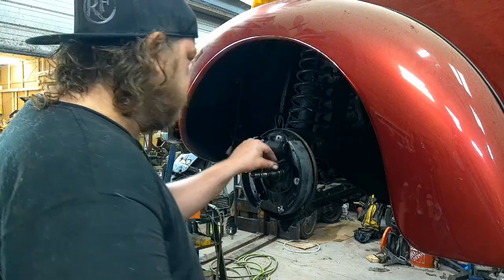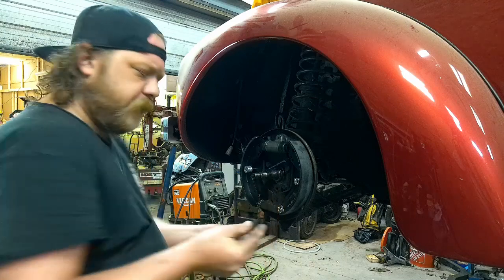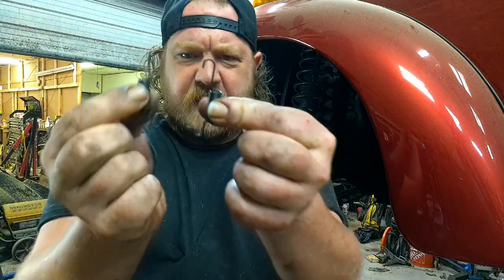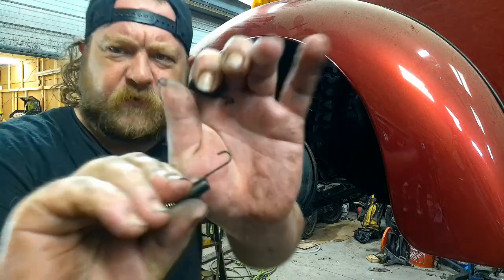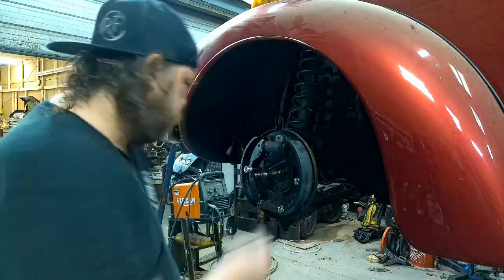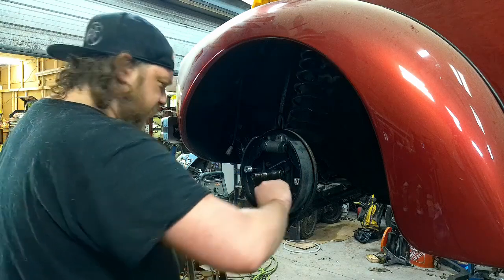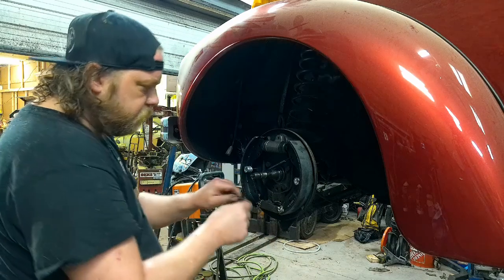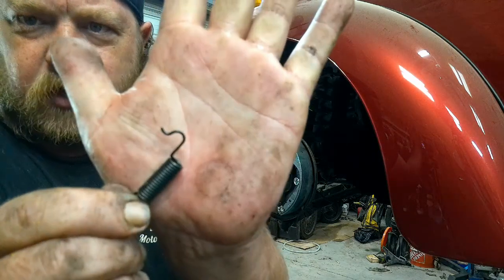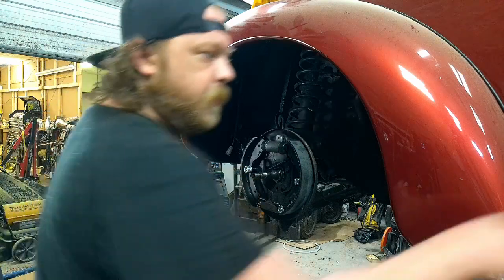Now for your springs, there's 3 of them. On the new kits, there's a longer side and a shorter side. The longer side with just the hook. I don't know if you can see the hook. It'll go into the weird crevice that you have. And with the curlicue at the end, those hook into your actual drums.